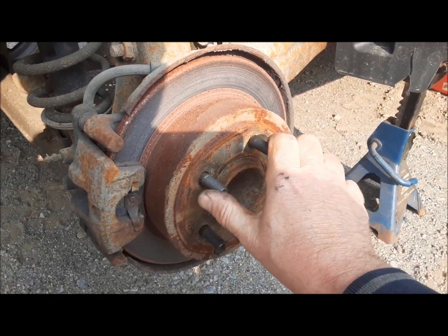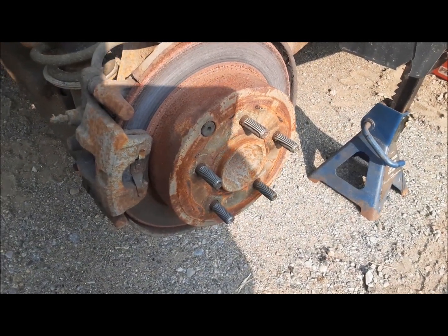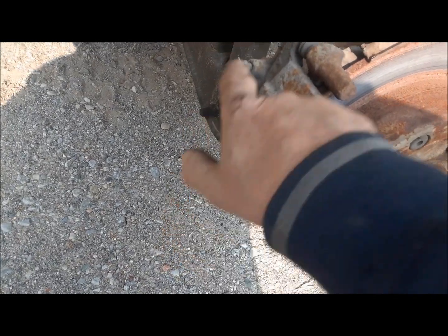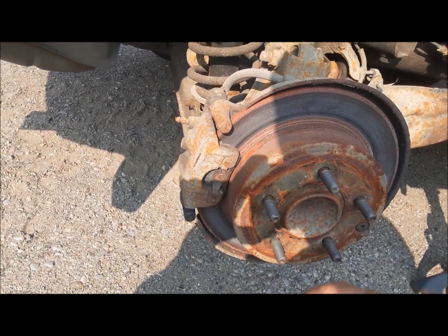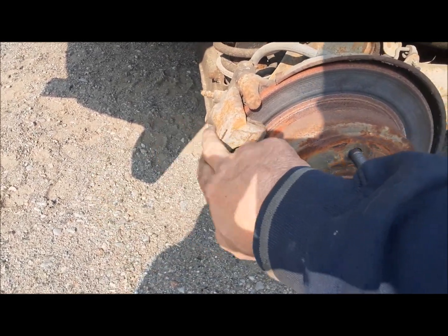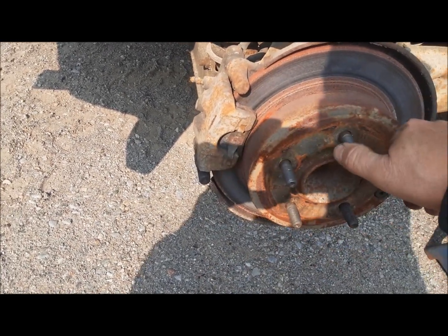I'm going to go in the car and punch the brake pedal a couple of times, then come back and make sure this thing is releasing. It's stuck. We've definitely got something hanging up here — I wouldn't imagine it's the caliper piston, I'm pretty sure it's the caliper slide bolts. I've gone ahead and ordered pins and booties for the calipers, and since there's going to be torching involved, I ordered seal kits too. We'll overhaul the calipers, redo the sliders, and I'm going to put a set of pads on it since it's fried down this side from dragging.